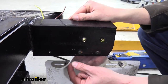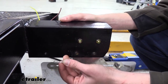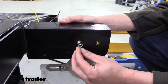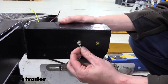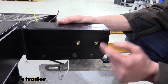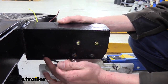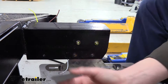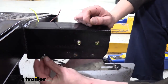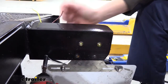Now that our light has been mounted up, we can start connecting our wiring. Our ground wire will connect to any point on our trailer frame. You could put it on one of the mounting studs, but if you do, make sure you clear the paint off the back side so you've got good contact to ground. Our customer already had a self-tap screw for the ground stud, so we're just going to reuse that since we know it's going into a clean, unpainted surface, and then we'll tighten that down.